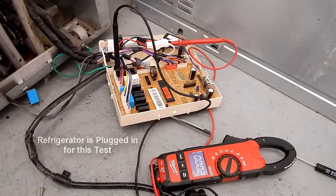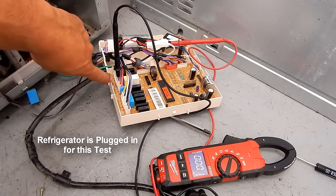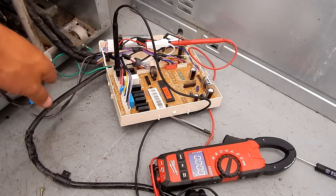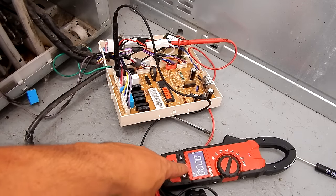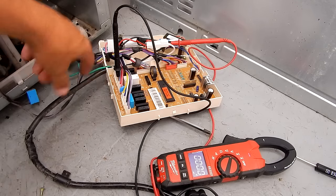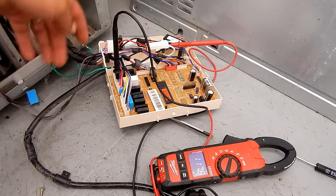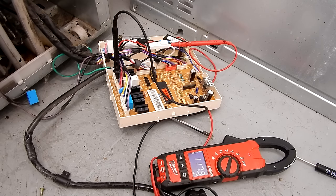Now we have to check the relay. I've put my meter on the hot side of the power coming in off the cord, and the other lead is on the sky blue wire, with my voltmeter set to volts AC. This relay is not making contact — it's not closing the neutral side of the circuit to allow the compressor to run. There's voltage getting to the compressor and back to this point, but without the neutral closing, the compressor is not going to run, and that's confirmed because I have absolutely no voltage. Now if I jiggle this wire it's going to stress the board just enough that the relay contacts inside might connect. My lights are flickering — there we go. I jiggled it enough that the relay made contact to the neutral. I got my 117 volts and I can hear the compressor running — a nice little hum and I can feel the vibration.